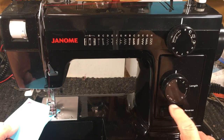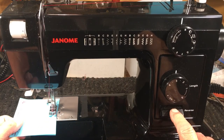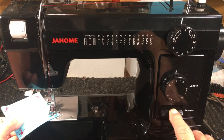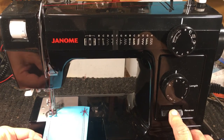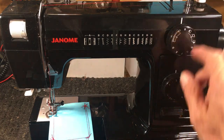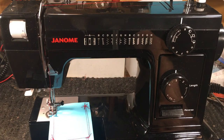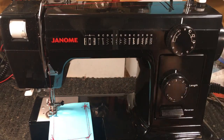It performs well. The reverse button is plastic — I guess that would be an 'all-metal plastic button.' The dials are a little more reliable than a lot of machines. With many machines — Brother, Singer, whatever — I'm reluctant to turn the dials because the mechanism inside can snap off since it's all plastic. This one has nylon on the inside for the non-stress decorative gears and followers.